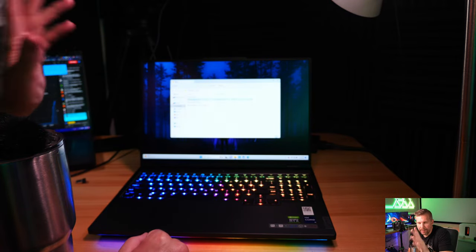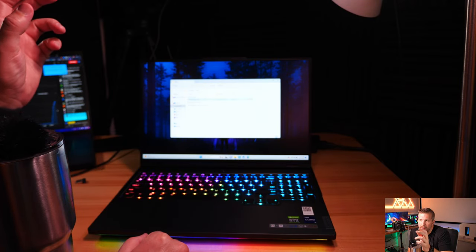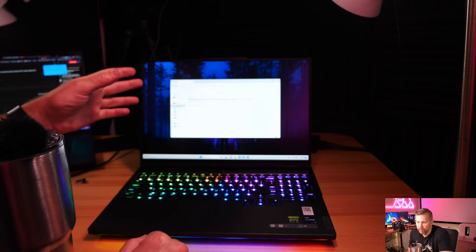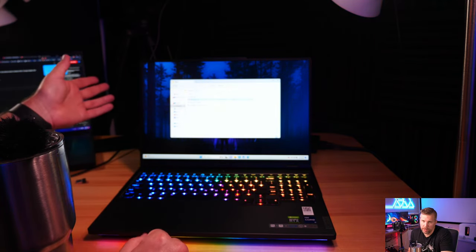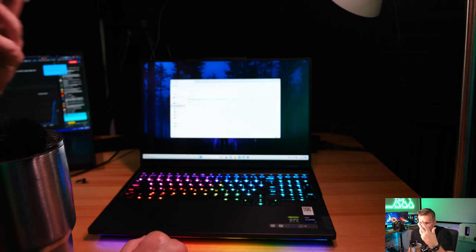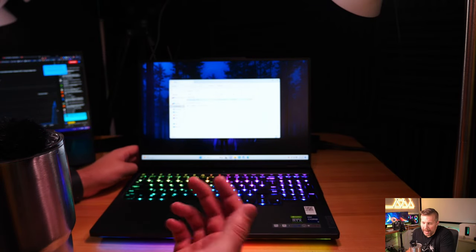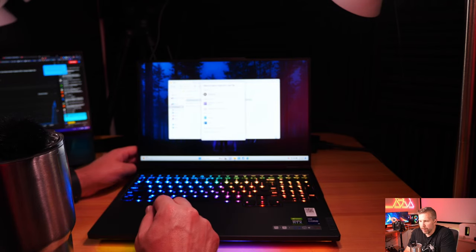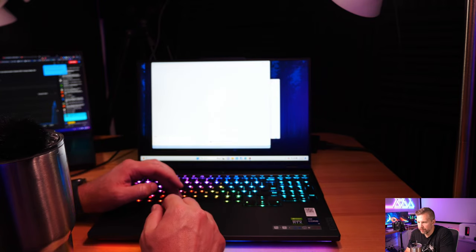But if you're a graphic designer, video editor, someone like that, not having 100% or close to 100% P3 color gamut or Adobe RGB coverage is going to be very noticeable for someone who's very sensitive to the color gamuts and how saturated things can look, or how potentially color accurate things can look when it's tuned correctly. And that'll be a really big deal to those people that rely on that in a screen.